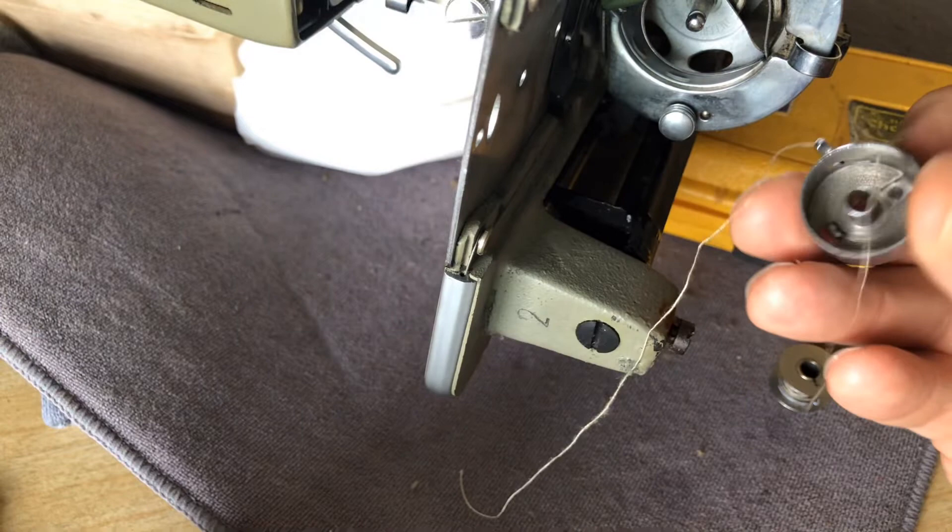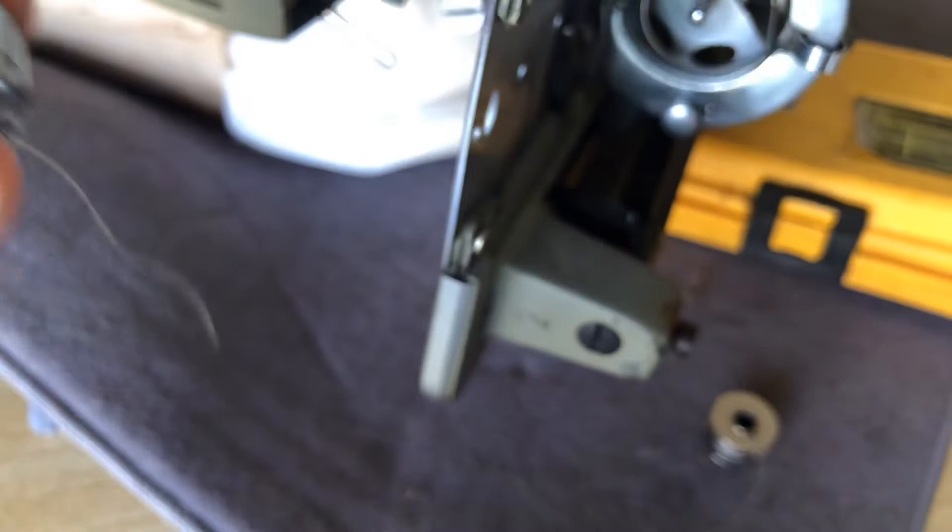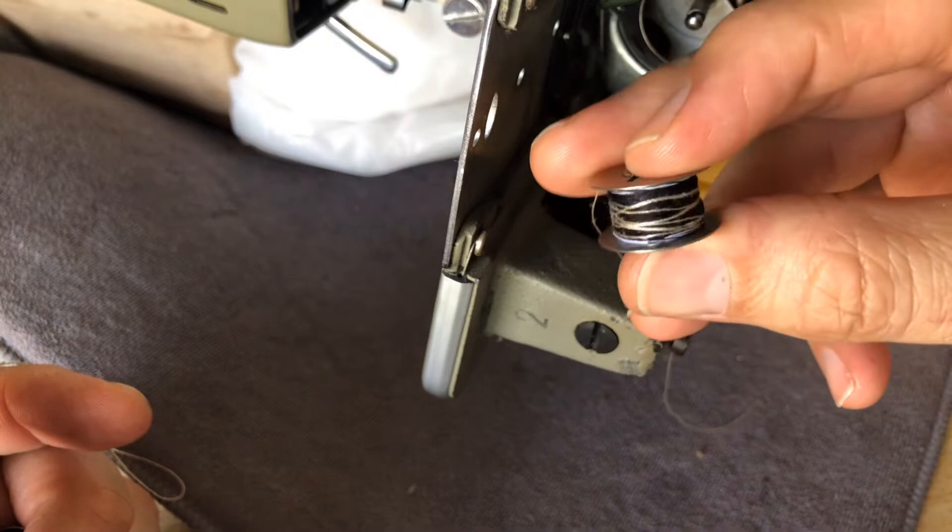It's incredibly important to the quality of your stitches. So now I'm going to cut the thread — this could be 50-year-old thread. I typically don't use old thread unless it's in good shape, because if I pull on it and it breaks too easily it might be dry rotted. You can see someone has gotten different colors on here and I'll be fixing that.